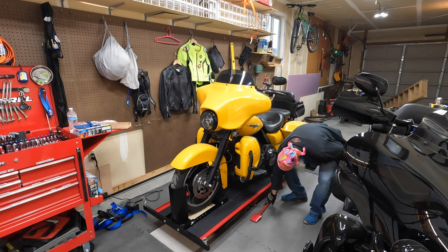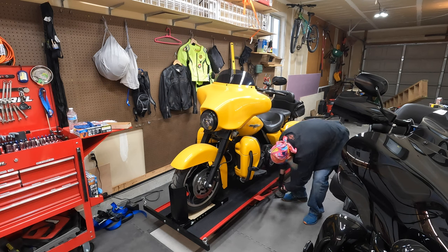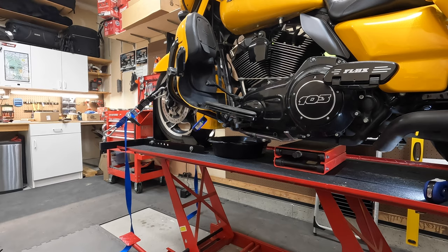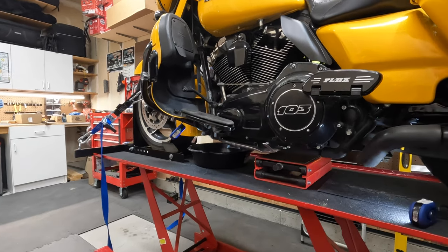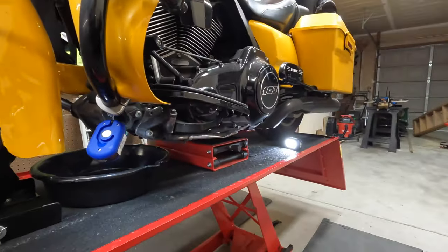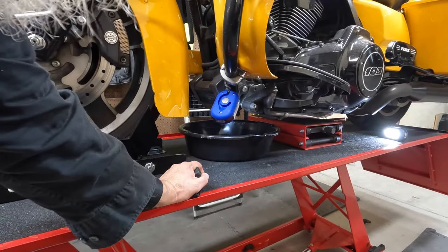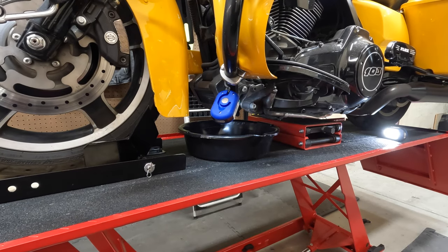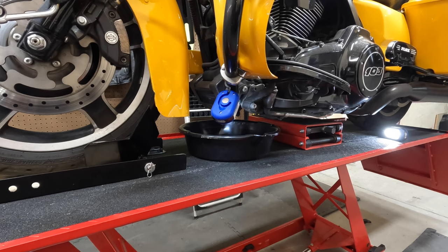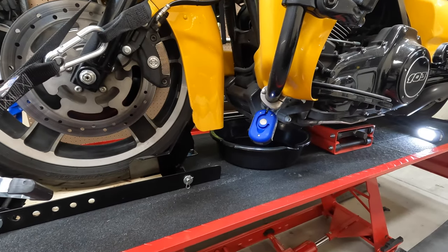Still quite stable. Let's bring it on up. Check that out — that's quite a bit more space. I don't have to sit there and fight with it when I'm pulling that oil filter off. I don't have to fight with this chock with the steel being back here another eight or nine inches — I've got room to work. I should be able to drain my oil filter pretty easily without making too much of a mess. That's the cheapest, easiest fix I think I've made to that chock. Between all the silliness with washers and plywood and the like, ultimately it was just too long.